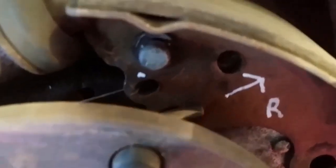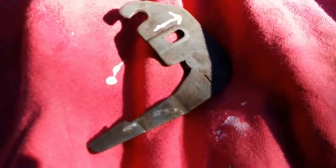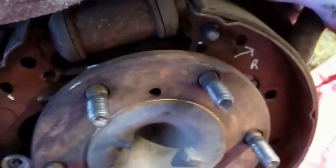The shoe's in place and the springs are also in place along with the spacer. There's a spring being clipped around there, and there's the right-hand side of the spacer. That's it there - and now this small arm here is the ratchet that sits around that round notch and just levers up on it, tightening up the drum brakes as needed.